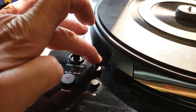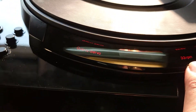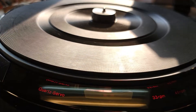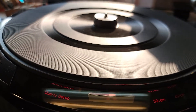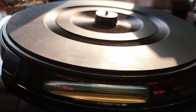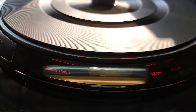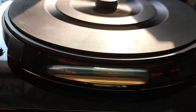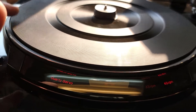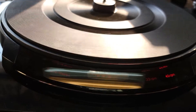I did run it up for power. I've got the quartz servo button depressed, so on 33 you can see the indicator there. If you look at the strobe — we're in kind of sunlight — the speed is rock solid on the quartz servo. That's 33, and if I switch to 45, same thing — it just jumps right to solid speed. Heavy, heavy platter, heavy, heavy plinth.